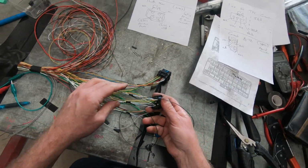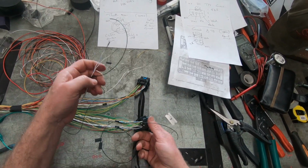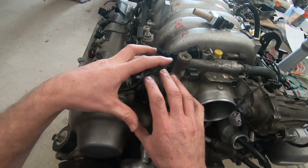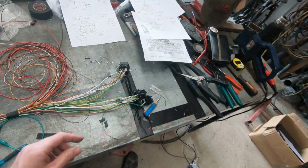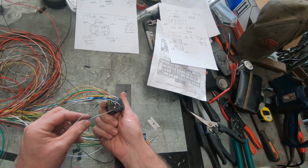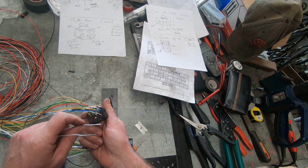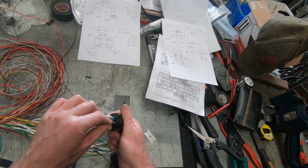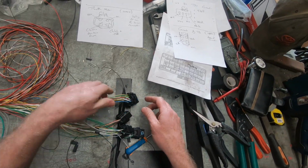Whew. And there it is, APS, accelerator position sensor. So that's this unit here. There's the plug, going by the diagrams. Pin 1 is white. So I'm putting these myself into analog volt 10 and 11, but it doesn't actually matter, because you can calibrate them and change them around appropriately when you're setting up your link, when you're setting up your profile.